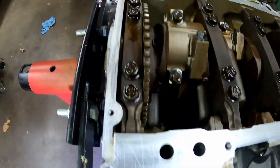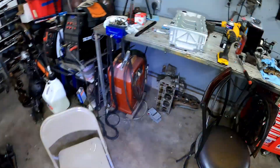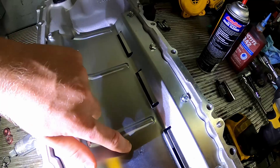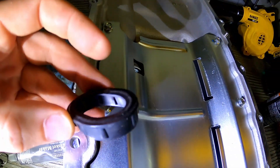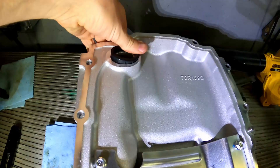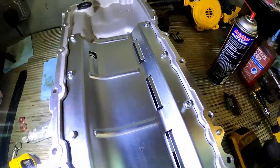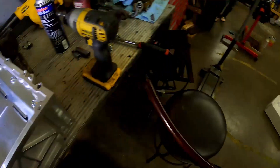An interesting thing I'm starting to love is that LT motors don't use a standard oil pan gasket like the LS had. LTs use o-rings instead. On the new oil pan there's one o-ring here and one there, and the pickup tube is cast into the pan with a separate piece bolting on. It's a weird shape - flat on top but fits down a groove - and it has dowel pins to make sure everything's lined up. Then you just bolt it on with some gray RTV.